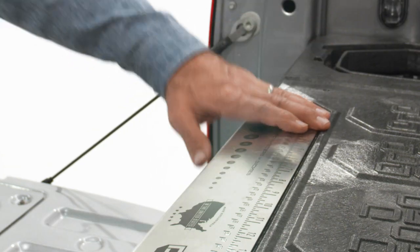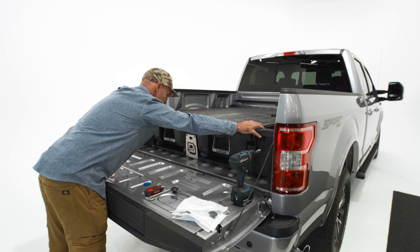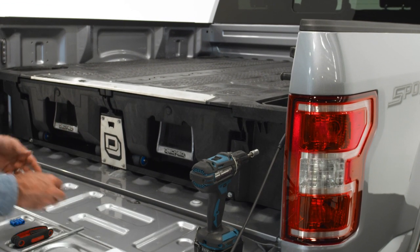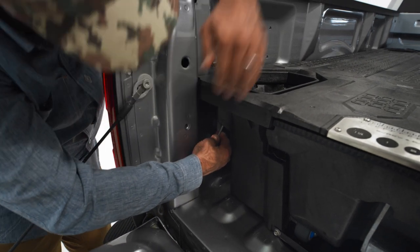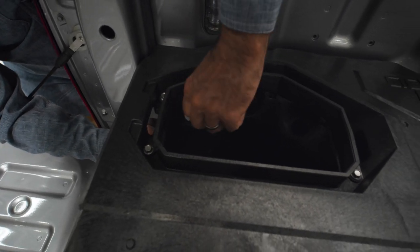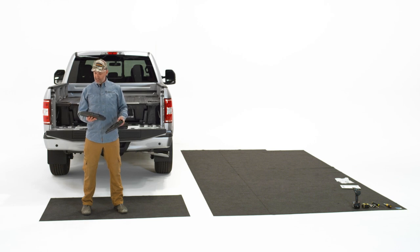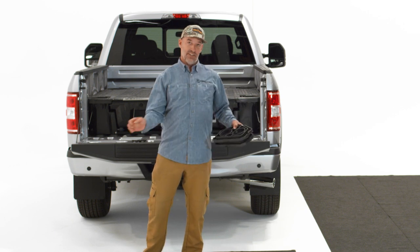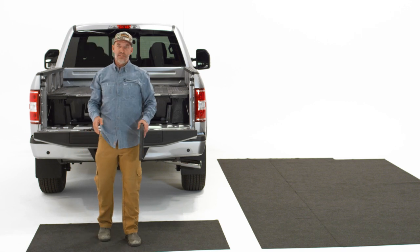Ruler's on, bottle opener's on — one more step: attach the corners to the tie-downs to secure the deck system to your bed tie-downs. Make sure the deck system is centered in the bed, put it into position, and measure off the ribs to make sure all parts and pieces are aligned. Get your J-hook and your spherical nut washer and do the installation of the J-hook. We're almost there — the last step is to put the little ammo can window lids into the access ports, then install the ammo can lids. The lid will say driver cab, passenger tailgate, or passenger cab, driver tailgate — it's a cross formation — and it will snap right into place. Do that three more times and your deck system is ready to go.